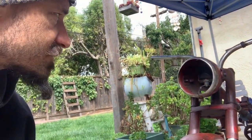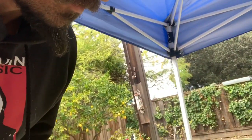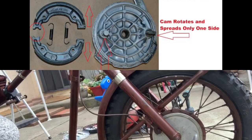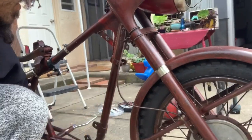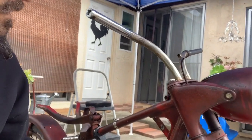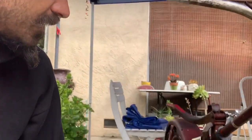There's tons of room to add more stuff. The old odometer is up top — I thought about pulling it out and putting in a voltage gauge, but my handlebar will actually have one already so I might just leave it looking old. I do have to order a new cable for the drum brake. The cable housing has a cool old spring design; I thought I might run the new wire through it and keep the look. A lot of what I've been doing is knocking out dents, removing rust, and prepping the handlebars for when the new motor controller, throttle, and brake controls arrive in about a week.